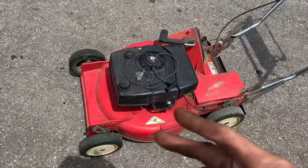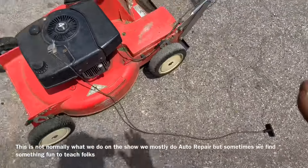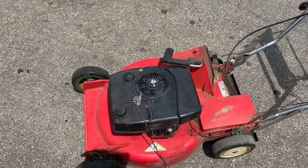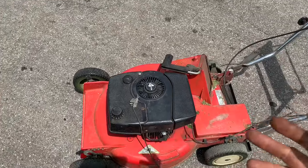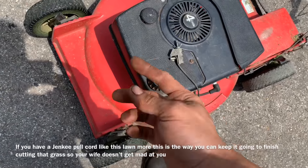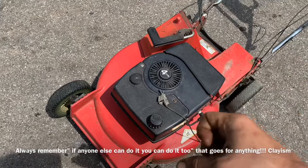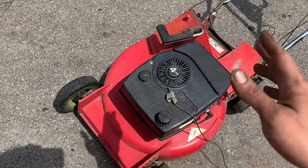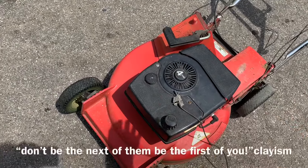Just in case you didn't catch what we did — the cord was hanging all the way out, just like this. I'm 43 years old, I work on cars all the time, so I can take this apart and fix it properly. But I simply lifted up the lawnmower, spun the blade backwards, and with a little bit of tension on the cord it sucked right in. It seems to be working every time now, and it's never recoiled properly until I did that.